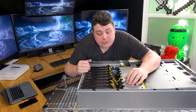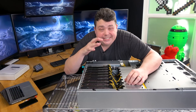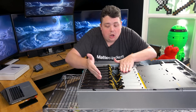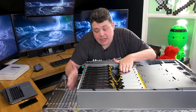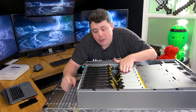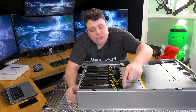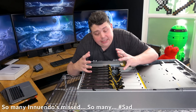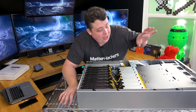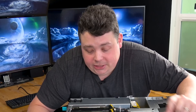When I first posted pictures to Instagram, a lot of people asked how in the hell do you get any airflow through these graphics cards? The simple answer is through brute force. This case is designed to create very high static pressure. There's ducting that has been added — it's not quite long enough for these short graphics cards, but with the lid on it does push a ton of air out the back. When they used a FLIR gun to check internal temperatures, they always stayed within a tolerable level, even with a slight overclock. If you have full-length cards, you can screw them into the ductwork to physically connect them and force the air through. There are eight fans in here and they sound like a jetliner when you fire this thing up.